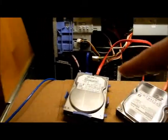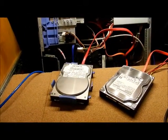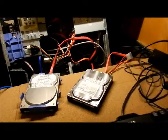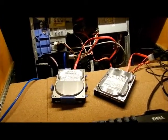I did try this hard drive — this is the internal of this computer. It was sitting in there and I had the 1TB USB hookup over here, and it wouldn't even see it in disk management. Actually, disk management did see it, but Partition Assistant did not see it. So we already know that Partition Assistant does not see the terabyte out on a USB 2.0.